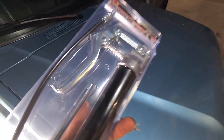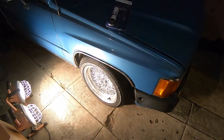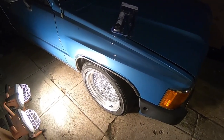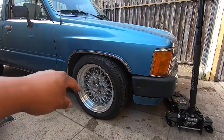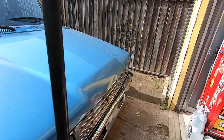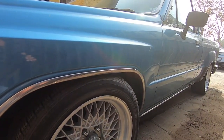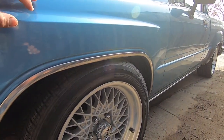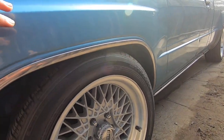We went to AutoZone and picked up a grease gun to grease the fittings. We're gonna open up the tie rods just to get it close enough for the alignment shop. We took it around the block — it's a bit too low so we're gonna raise up both sides. We're going to mess with the torsion bars again. We're thinking of going up just enough so you can get a finger's clearance — or even less — as long as you can see the top of the tire.